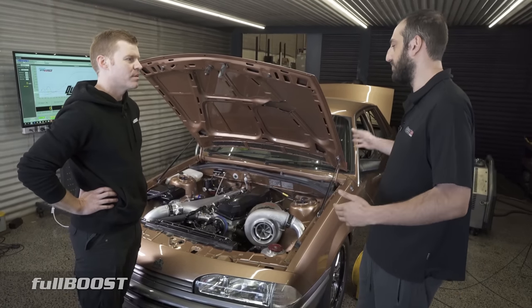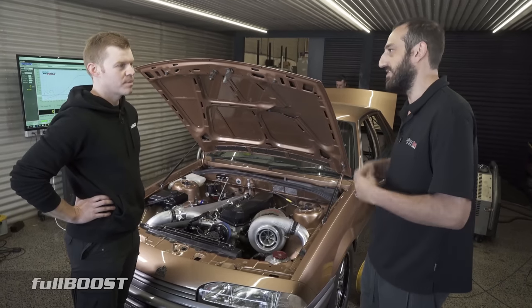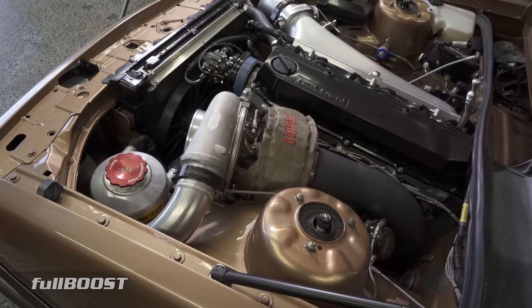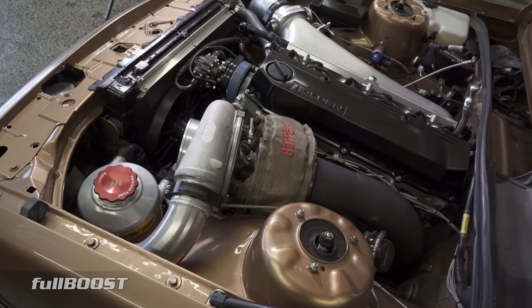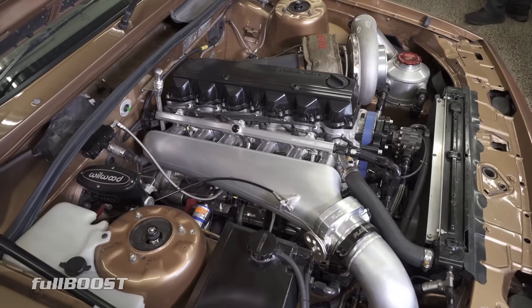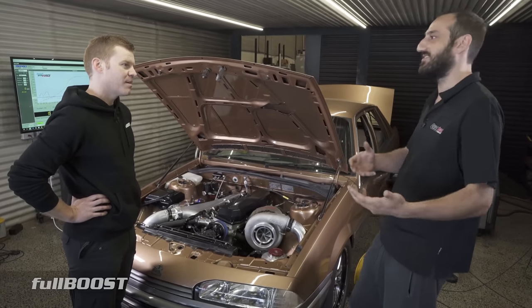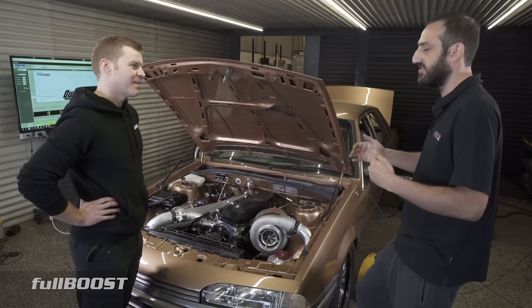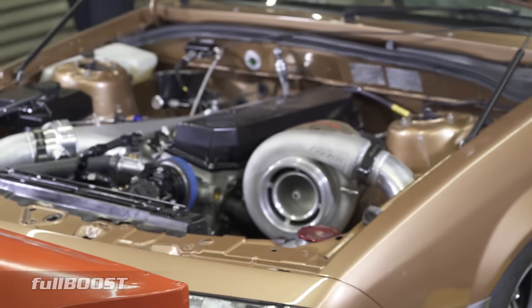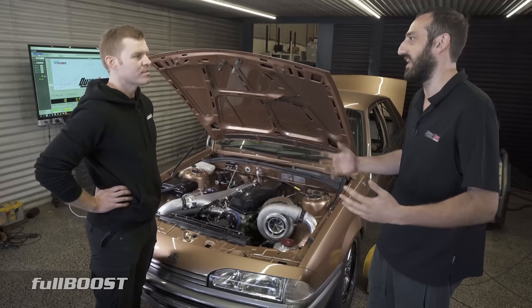And that's again a beautiful thing. You've got a fuel pump — a prime pump that's about to die. You see the current go right up, then it will trip the circuit, give you a warning, and then you've got a DTC and the ECU will kill power. So it's very easy to diagnose. You're not sitting there pulling fuses. You'll be surprised what you learn just by looking at the current draw on some channels — it's usually a telltale when an auxiliary device is starting to fail and overloading the circuit. You don't see that on the fuse — it'll just pop when it's too late.